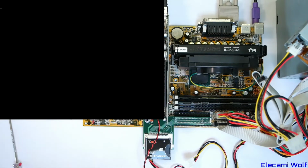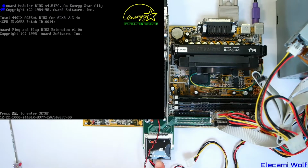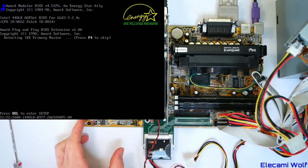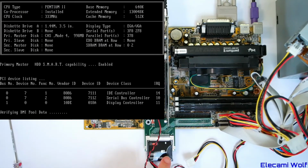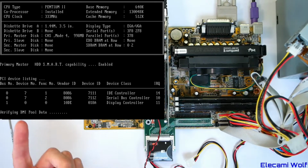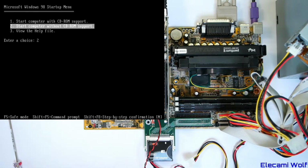Okay, so we'll reboot and we'll see if the drive comes up or not. I was playing with this. Oh no, that was something else. Yeah, on the live stream, I think it was, I was trying a SATA to micro SD thing on an old laptop and that just would not work. You could run the fdisk, create the partition, after you reboot, partition's gone. And we tried different SD cards, no effect.